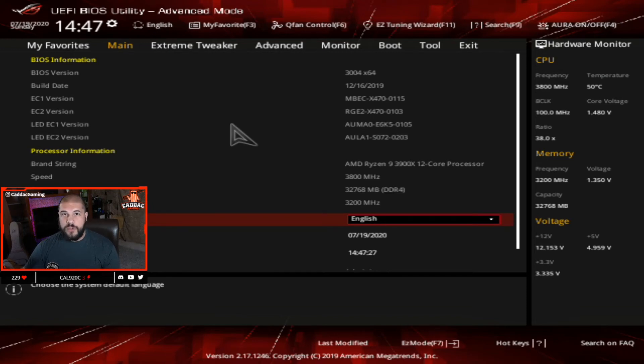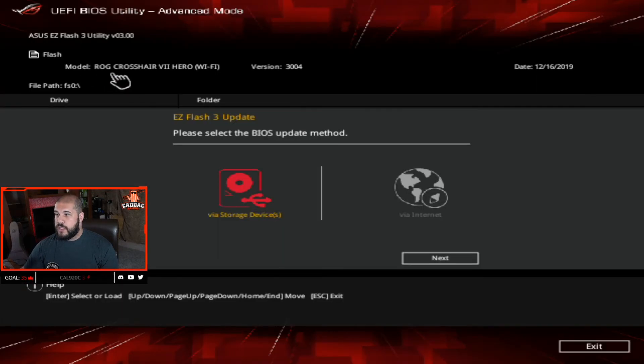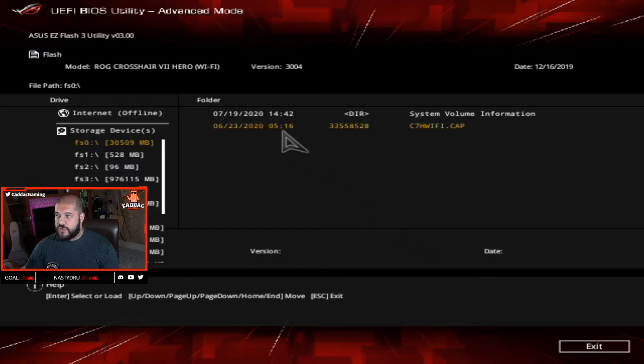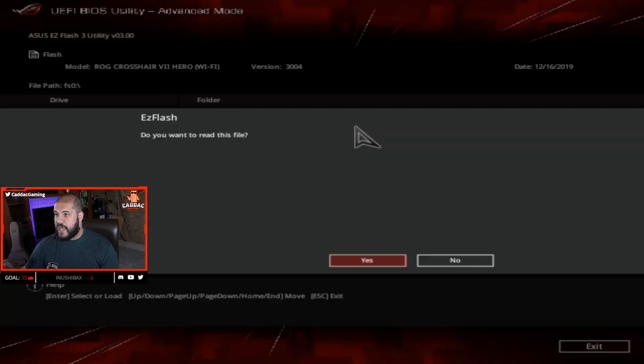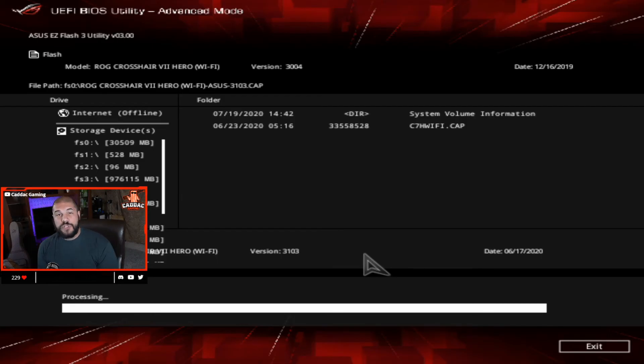From here, you're going to want to go to the tool menu if you have an ASUS motherboard, or the equivalent in your BIOS for your manufacturer. On ASUS, you're going to go into the Easy Flash Utility — click on that. We've put our BIOS on a USB, so we're going to select USB storage device and go to next. It will find the drive that has the CAP file on it. Select that CAP file, select yes when it asks if you want to read. Now it's going to go through the process of updating the BIOS — it's going to ask if you really want to update, showing you the version and the date. Go ahead and put yes, and just let it process.